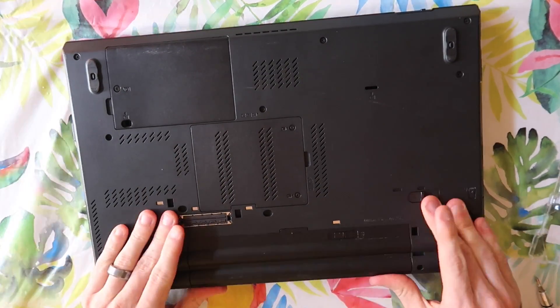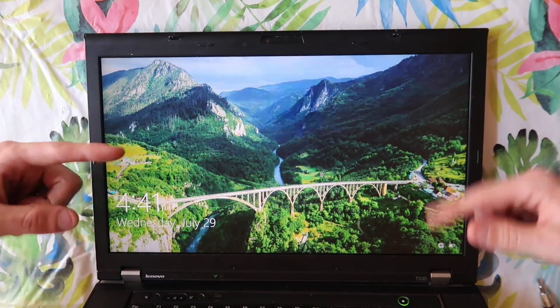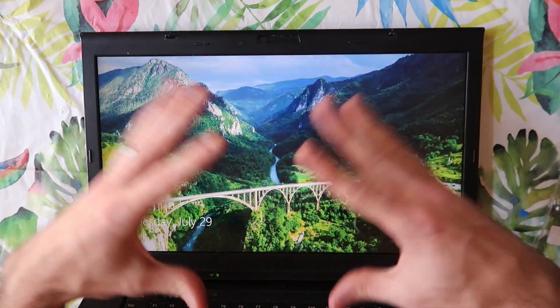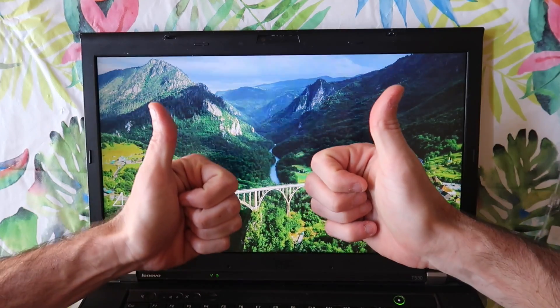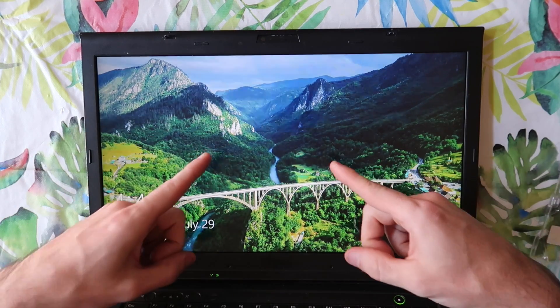Now we're going to put the battery back in and turn it on to make sure that the LCD is working. You can put the battery in earlier if you want to double check, just to make sure everything works. But I'm pretty confident this will work perfectly fine. And as you can see — bam! Look at that. The wavy lines are just on the camera, it doesn't look like that in person. But that is the LCD repair. It's not that hard. Once you get the right part number and model number, you can buy a used part off of eBay and put a little work into it. This was 11 screws, an eBay part, about 15 minutes of time. Thank you guys so much for watching. Please give the video a thumbs up, put any questions in the comments section, and I will talk to you in the next video. One more computer saved from the trash.